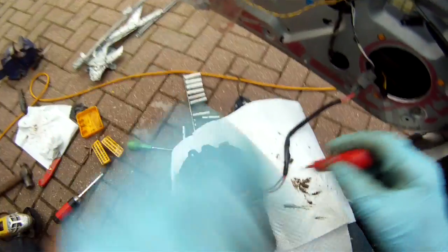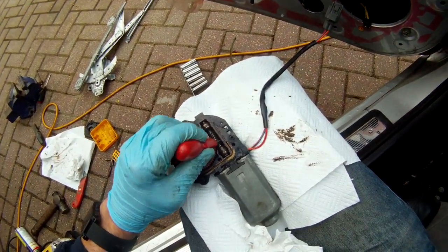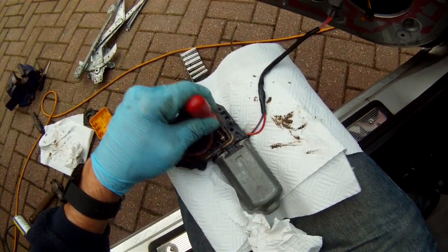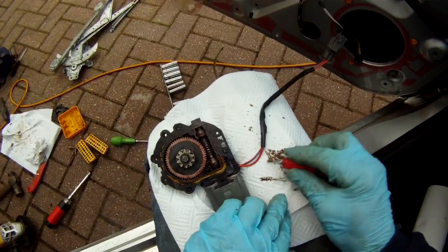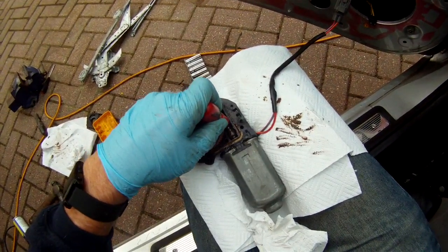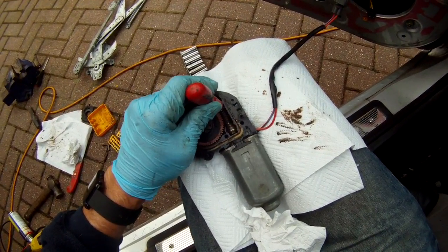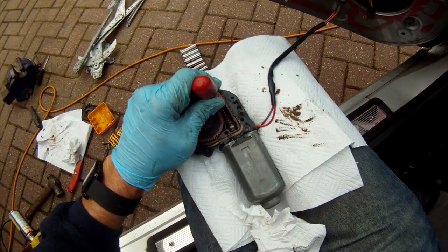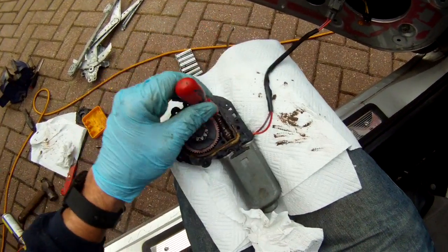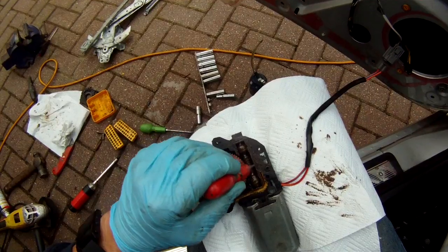Another way to give it a useful final clear out is to get a small screwdriver, jam it in the slot while pressing the button to activate the motor, and it gives it a final clear out of every part of the slot on the gear. Keep doing that quite a few times both ways. Clean off the screwdriver in between, see all the rusty stuff that's coming out, and it's now starting to shine with surface of metal showing.